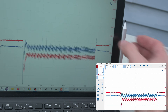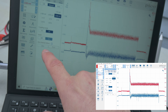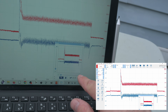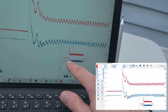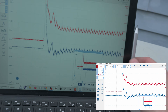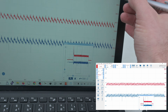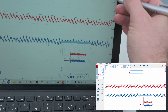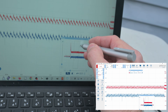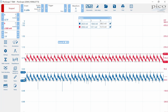I'm going to re-invert this again because that's how I like to look at it. Let's zoom in. At the beginning, the waveform is going to consume a fair amount of voltage because it takes some effort to get that engine moving over. What I am looking at would be this part here — I'm looking at the peaks and the valleys of my waveforms. What I see there is compression, and this is the compression every time the engine turns over.